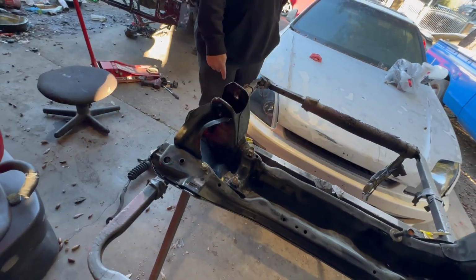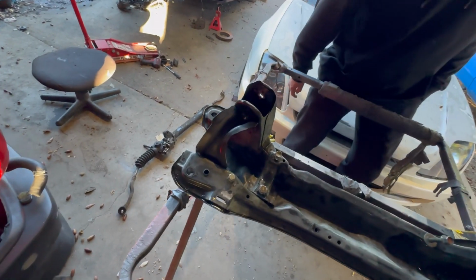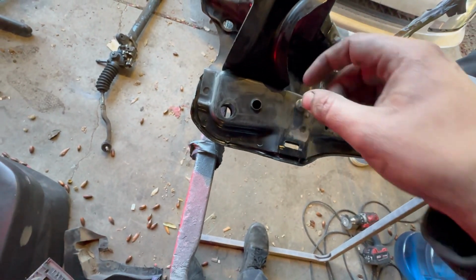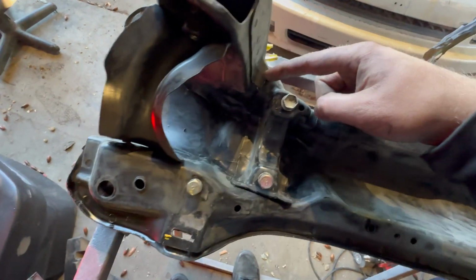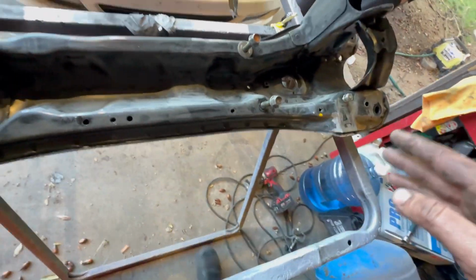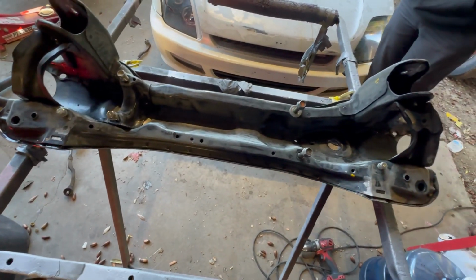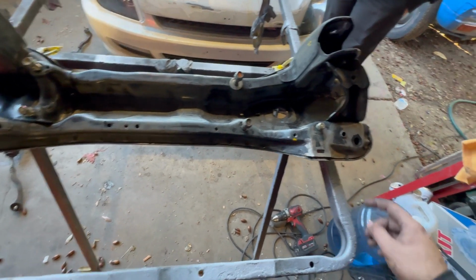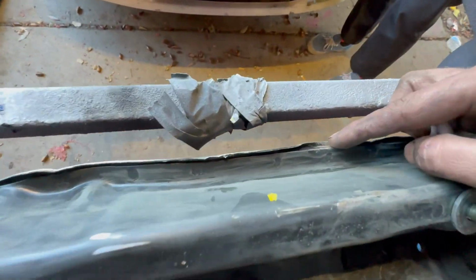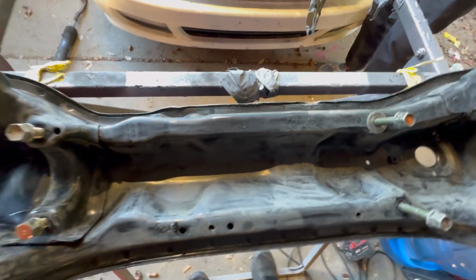Anyways, we're gonna get a loop line for that so you can pour some power steering fluid in so it doesn't burn out. But what I'm gonna do, because even a spot weld broke here, is bring this back and weld across, and weld all these legs because even this leg started popping up. I'm just going to reinforce it, make a plate like this one on this side, just to give it some extra strength and rigidity, and then weld up the areas so they don't peel back like this side was doing. So I'll probably peel this side back and then weld that too.